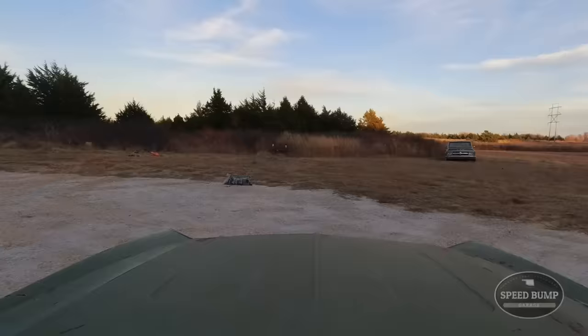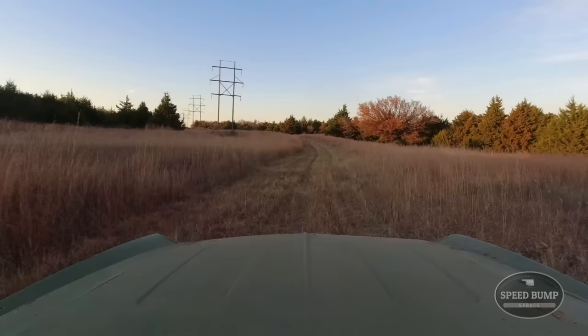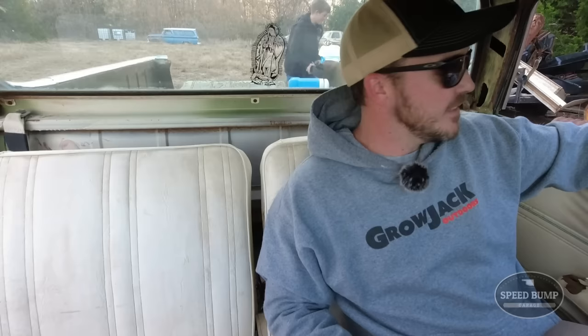Hit the brakes - oh yeah, that's way better! It's so much better. It's like a different car. Jack's unloading all the old brake parts and suspension parts in the scrap trailer, and as I'm sitting here I'm seeing our heater core pouring antifreeze onto the floor. We had just straight water in it but now we've got a nice green puddle on the passenger floorboard. Definitely going to need to bypass that until we can get a new one.